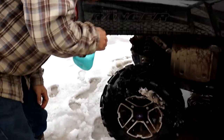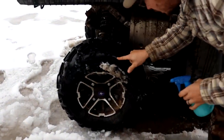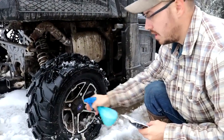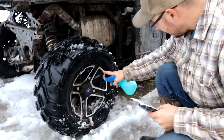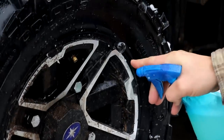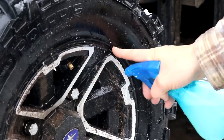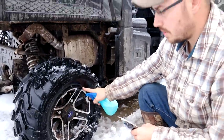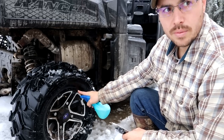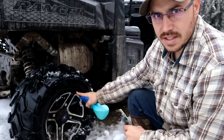We haven't found it yet, but it went flat pretty fast. I'm pretty bummed — we got the Polaris with the shiny fancy wheels, and I felt it hit a rock yesterday. See the bubbles there? We pinched the sidewall. We also noticed I need to put a little more air pressure in these tires — they're just a little too soft for all the rocks we're going over. In a car, you pinch the sidewall and your tire's done — you've got to get a new one. But in an ATV like this, just going on trails, it'll be fine.